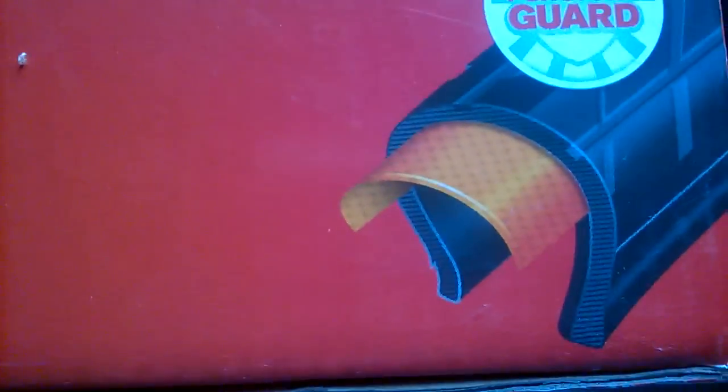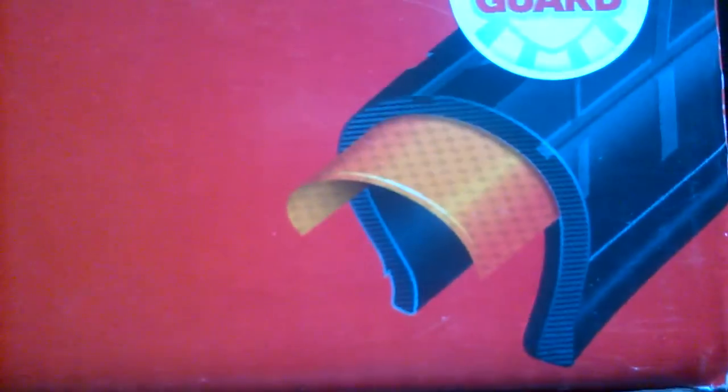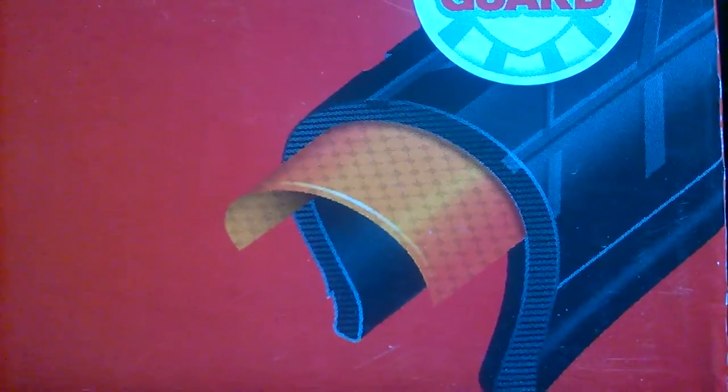See that liner built into that tire? It's not kevlar but it doesn't have to be. You can buy liners separately and put them in yourself, but I like the integration — this one is molded into the tire. The one I have separately is loose, and the problem is it can move around inside the tire and won't protect the tube. Whereas this one, molded in, stays in place 100% of the time.